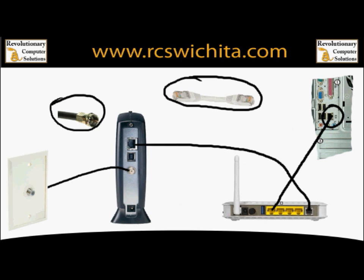That's basically the wiring diagram for hooking up a cable modem to a router. You're also going to have a wireless signal if it's a wireless router, which will go out to laptops, Apple TVs, Rokus, or whatever else you're running wirelessly. But in short: coax from the wall to the modem, ethernet from the modem's out port to the router's WAN/Internet port — that's the most common problem — and then one of the LAN outputs to the back of your computer. Hope that helps! Until next time, thanks for watching.